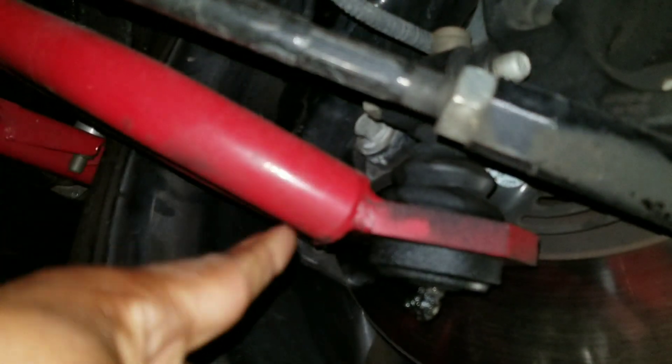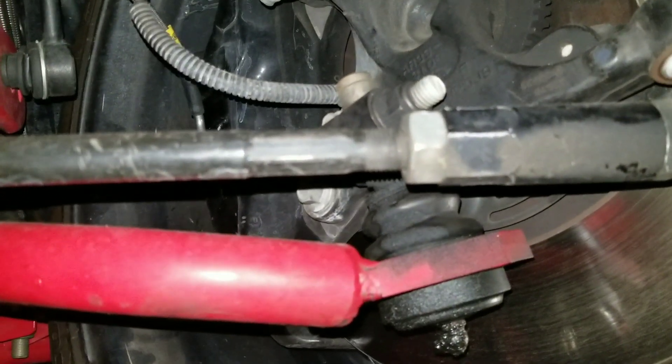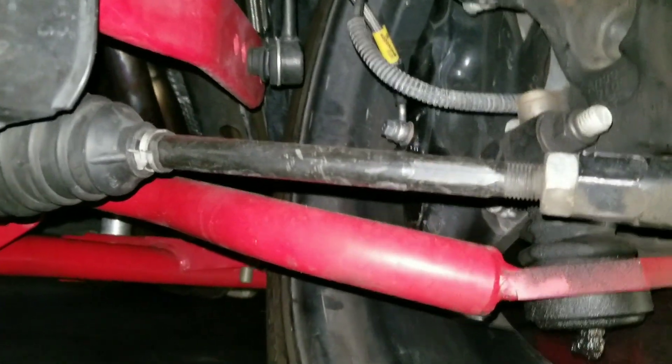Here's a better look at what I was trying to explain. If everything is the same length, it's too long to make any adjustments on the bump steer. What they had to do was cut it down a little bit and re-thread it so you had room to make adjustments. I'm not sure why that's necessary, but that's what the second mechanic figured out. Like I said, I had extra ones just in case, but they figured it out. The alignment is good and the tires are still good.